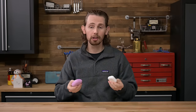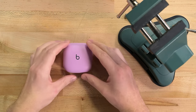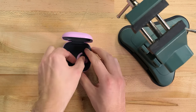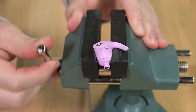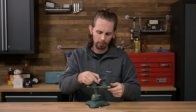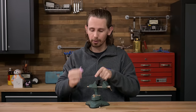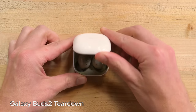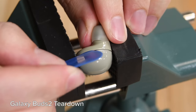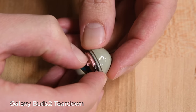In this dual teardown video, I'll be looking inside both of these earbuds and looking at the spatial audio feature that's new to the AirPods 3. I'll start with the Beats since they are surprisingly more complicated. As always, I'll be putting these into a vise which will deform them enough to break the adhesive seal that holds them together. This isn't the ideal way to open any device — not everyone has a vise, and more importantly, putting this much pressure on the plastic shell of the earbuds can easily do damage. The better buds we've seen use more flexible plastic and light adhesive that makes this process easier, but even those still require this delicate dance.